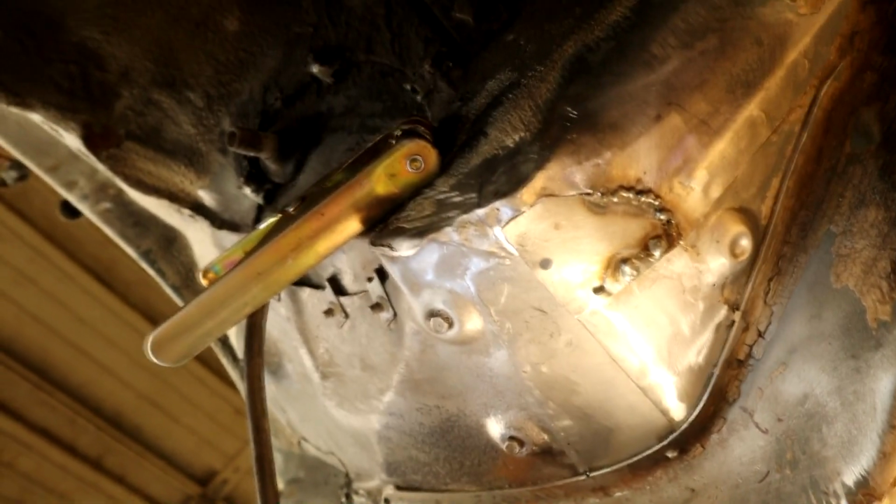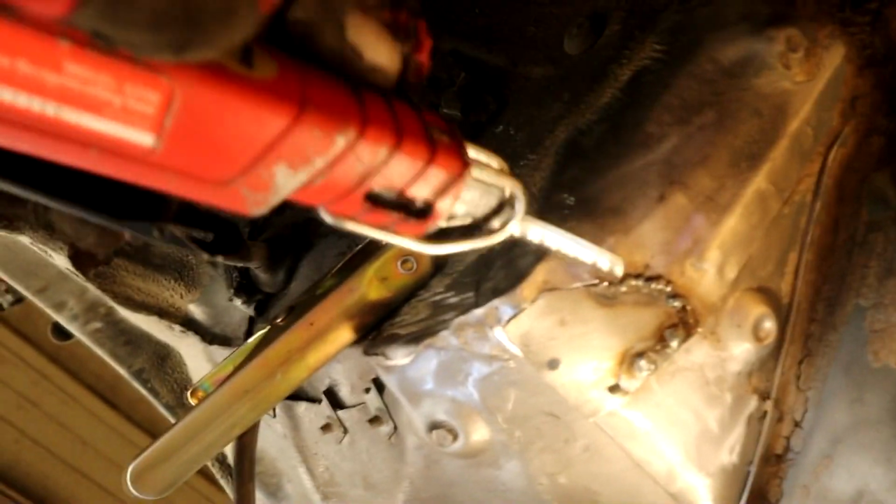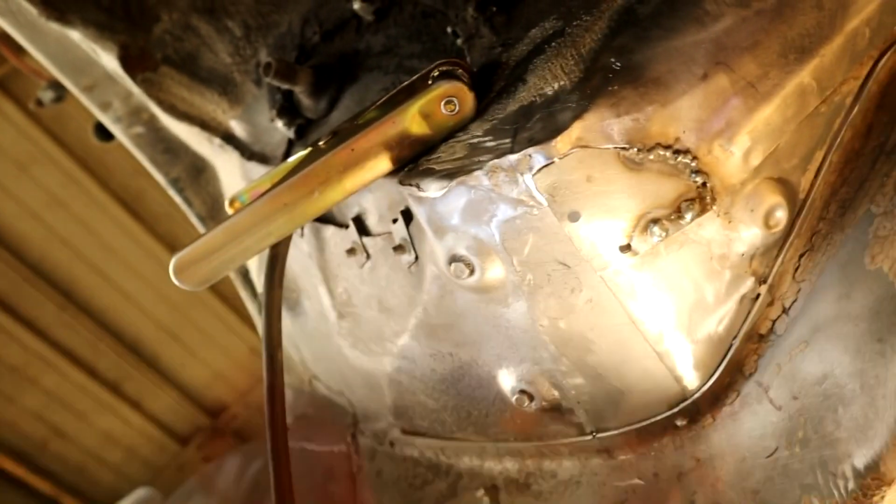So what I'm doing, I'm working along this seam here, and I'm kind of checking my level as I go, tapping together, making sure, and then I inserted the recip saw in here and cut, not straight on, but at a kind of chamfer angle, and then made space for the patch, and so I cut it in as I went. So then it's a perfect fit, and it's got a nice gap to it for penetration, the thickness of the recip's blade, or slightly thinner because we're on a slight angle. And this is going to go in really nice, I think. So working it as I go, tacking it and then bending it to shape as I go and working the metal. This has still got a gap here, but like I say, I'll screw that into place.